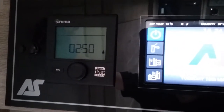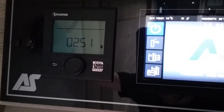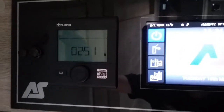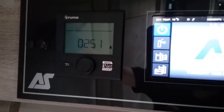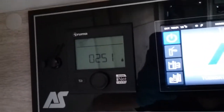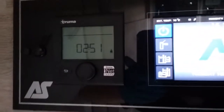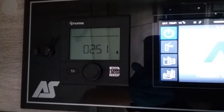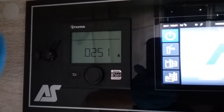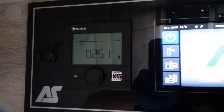If you've tried and the error still hasn't gone, go back to the warning triangle and double click on it — sometimes it will then say no error and disappear. If that doesn't work and you still have systems running, just turn them off. If that still doesn't work, turn the control panel off by holding the button in. If it still doesn't work, lastly do a factory reset, because nine times out of ten that will sort the system out.